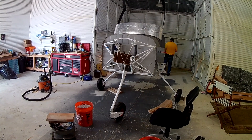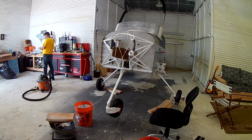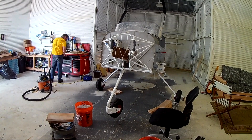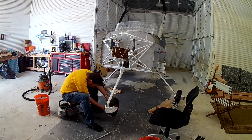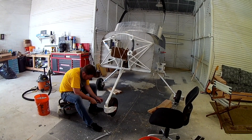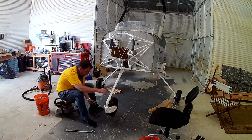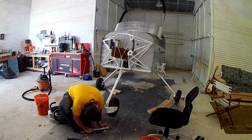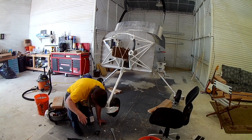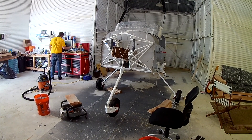Someone mentioned you need a spring scale to measure the amount of force required to move the front tire. We've got those Belleville washers and that big nut, which requires a one-and-three-quarter inch wrench. You tighten it up and then pull the wheel — the idea is that you want at least 25 to 26 pounds of pressure to move the front tire.